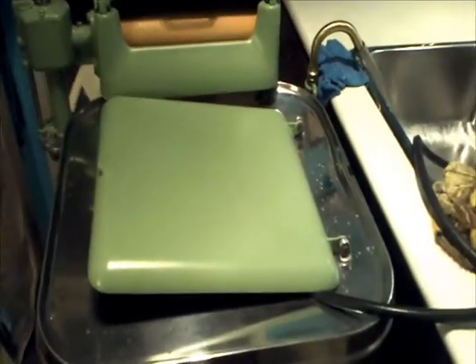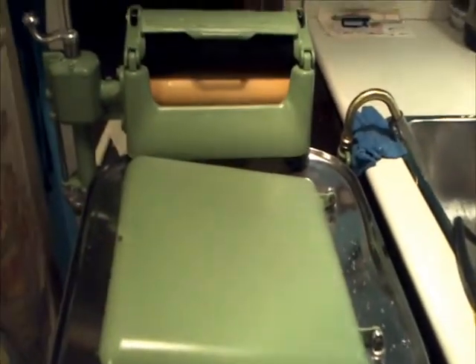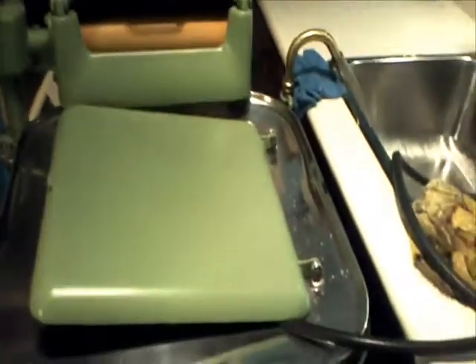In the final installment of this instruction series, the washing and rinsing are done. It's time to empty the tub, rinse it out, and prop the wringers in preparation for storage. The water is almost pumped out — just a little bit left. Then we'll rinse the tub out with clear water; this is always essential to remove any soap residue. Removal of the agitator is also essential — it should be dried and left to air dry. So we'll take that out and place it over there and wipe it off.